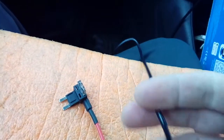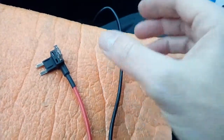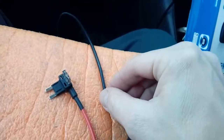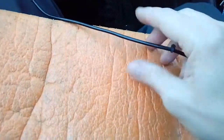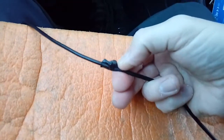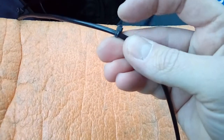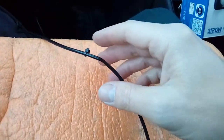Next, measure up your cable across the top of the windscreen. That's what the cable ties are for — we're going to wrap them around the cable periodically to bulk it up so it doesn't drop down when you hit a pothole. Wrap three around it periodically and then cover them in tape. The reason to cover them in tape is that when you cut a cable tie it can have a sharp edge, which could rub the inside of your headliner and make a mess of it.